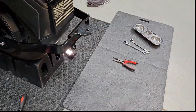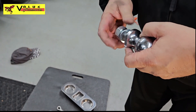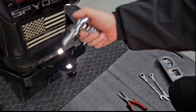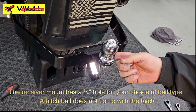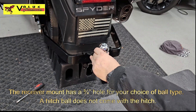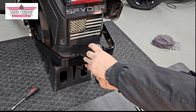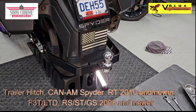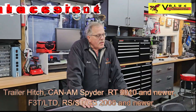You're wondering what ball to put on here — that doesn't come with it, but in most cases your small trailers are all going to use a one and seven-eighths inch ball. The BRP trailer uses a three-quarter inch shank, so we usually get the one and a half inch long shanks by three-quarter. Once in a while you'll need it set higher — you can use a couple of large washers underneath to get a little bit higher. They do sell some spacers if you need to go higher, but that pretty much does it for the hitch install.